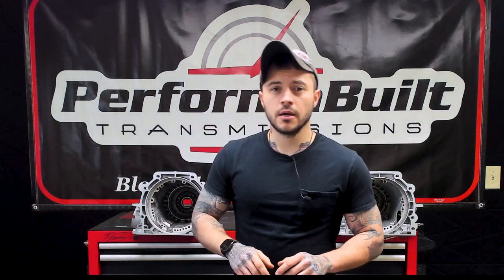This video is going to be a stock-for-stock discussion — we aren't going to really talk about aftermarket. The only time a 4L60 or 65 matters versus a 70 comes down to one simple electronic, determined by the standalone computer or the vehicle model you're using. Please talk to us first — chances are you don't need a 70. The Holley Terminator X Max is the only tuning software that truly needs a 70 with its 15-pin harness, though I believe they've made a 13-pin harness to work with a 60 and 65 for that program. It's a great product, but from my understanding it's the only one that needed a 70.